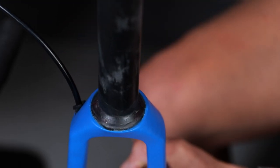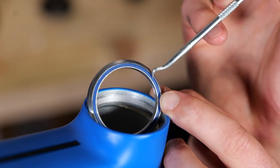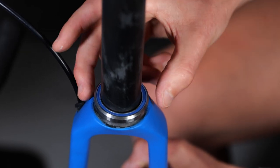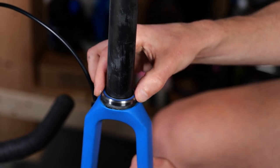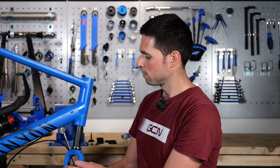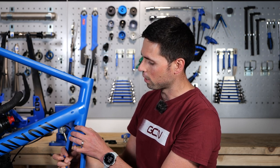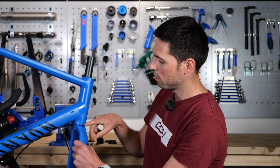This is the lower bearing. On the outer edge, you can see we've got a tapered angle and on the inner race, we've also got another tapered face as well. The tapered face on the inner race of the bearing matches up with the angle which is tapered on the lower portion of the fork. That means that the bearing slides over the top such as that, so that inner race has a smooth surface to sit against. The fork and the steerer then go up inside the head tube of the bike and the angles and faces of the outer surface of the bearing match up with what is on the inside of the frame, which means we get a nice flush finish there.